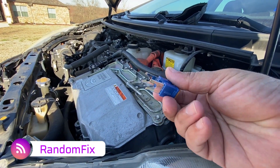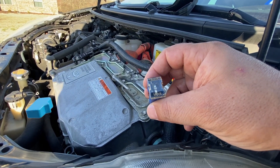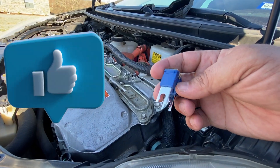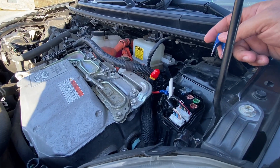In this video, I'm going to show you how to change out one of these bigger fuses, as they're not as easy as one would think. You cannot just pull these out as they are going to be bolted on the sides, and there's normally two bolts that hold this in. I'm working on a 2012 Toyota Prius Hybrid.